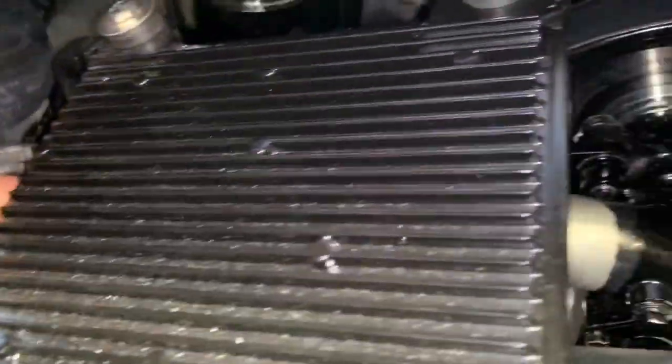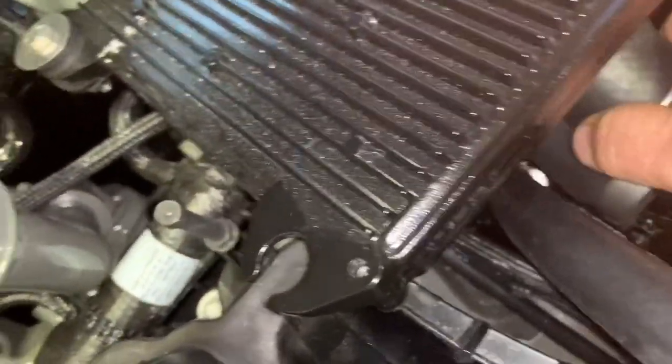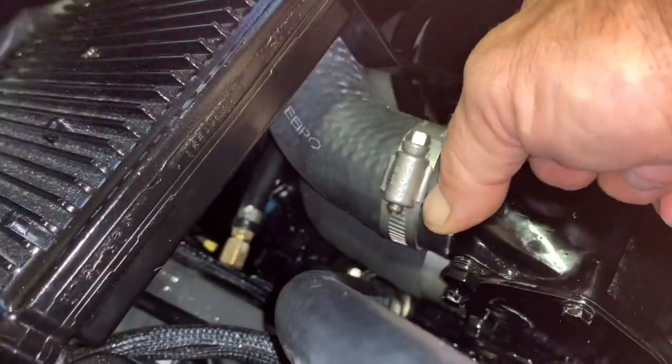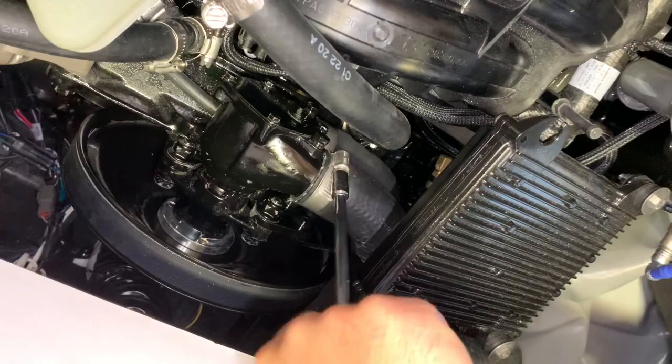Sometimes the paint will be difficult. You're going to route through this little hole right here. Be sure that this is all the way up and the clamp is actually on — the clamp needs to be on the pump, and you'll feel the hard pump on the outside of it. This area is soft, so this clamp needs to move right there. Then use your 5/16ths to tighten that up. Be sure the hose is on both ends before tightening, so it's clocked the right way.